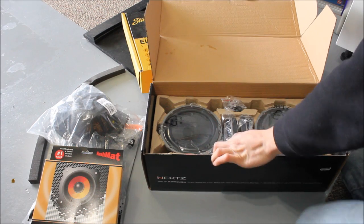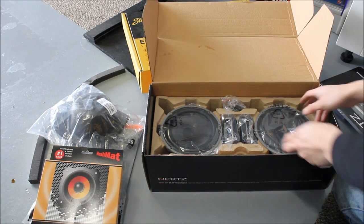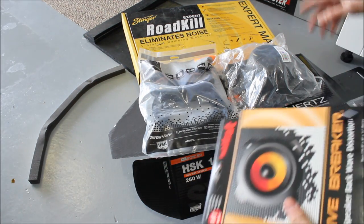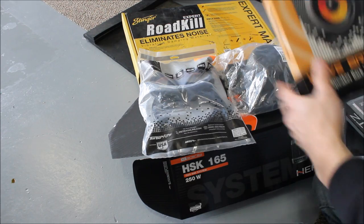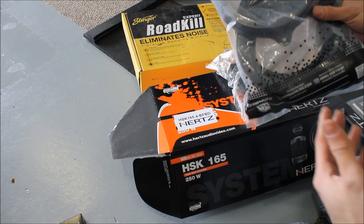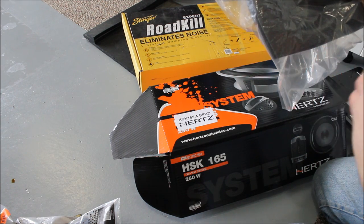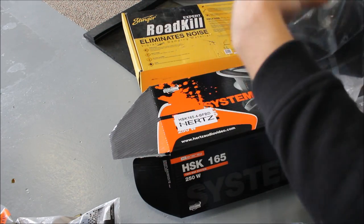What I like about this particular setup is the tweeters aren't huge, so they're going to fit nicely. I want to drill into the factory housing to expose them — that way I get better sound and I like the look of them. The mid-range woofers are quite large, but that's where this stuff comes into play. Behind the speaker, not only are we going to do sound deadening on the actual sheet metal, but then we're going to add wave breakers to stop the back wave from coming back and reducing any kind of distortion. After that, we're going to put more sound deadening down and install the speaker adapters because the factory speakers are a weird size.